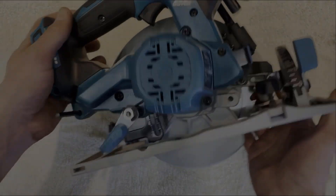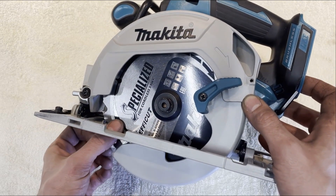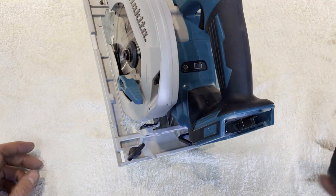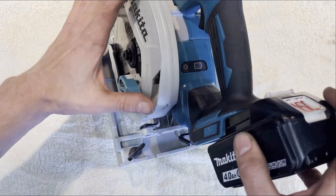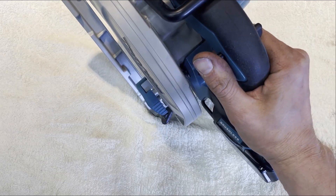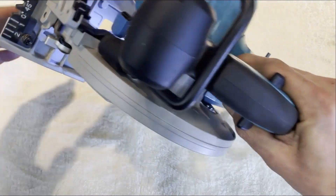Let's have a look at this little fella. This is a Makita DHS 680 from 2020, but it looks completely new - brand new. Look at the cutting blade, it's not even marked at all. The customer says it's just dead. When I put the battery on and press the trigger, it tries to turn but doesn't. The light comes on.